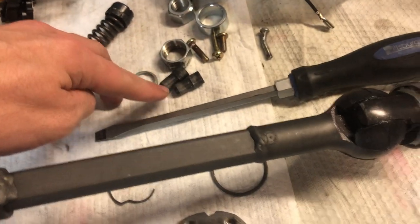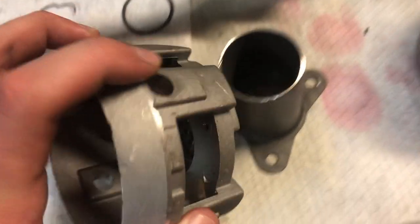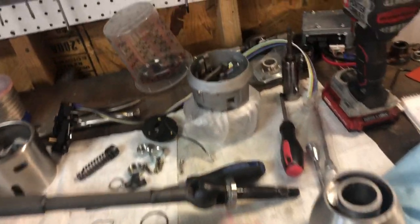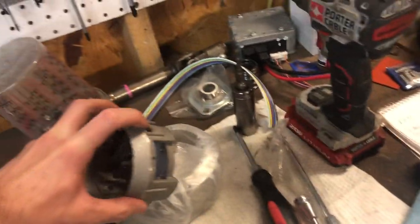It works the same way - it's got little cam lugs on it. You just push it in, turn it, and it pops out through this hole right here. Simple cam lugs. Now mine was a little tricky - this sleeve covers these little pins on one side. You can see where I dinged it up because I was trying to flex and bend it. One side came out no problem; the other side wanted to fight with me, so putting it back together might be a task.